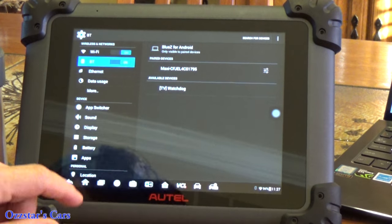Let's do a full scan — Diagnosis, Auto Scan. I am going to swap out the battery, but that won't be in this video. Maybe I'll post a separate video on getting the battery out — I think it's about nine steps to remove everything. The scan is going through pretty quickly. There are three faults in the air conditioning module already. Some of these might be current, some might be history. We'll find out in a second. This is a nine-year-old vehicle — newer cars will be a bit faster.